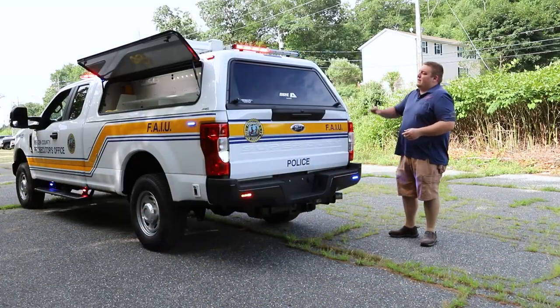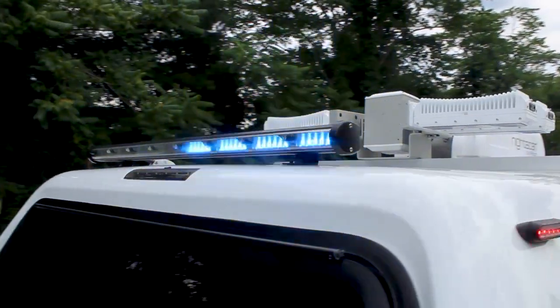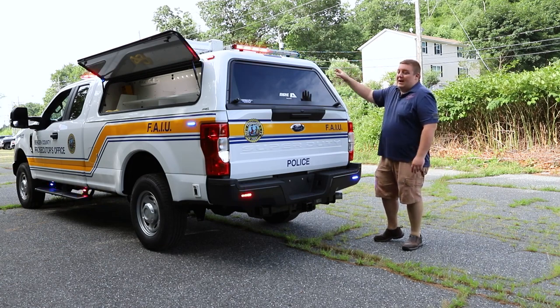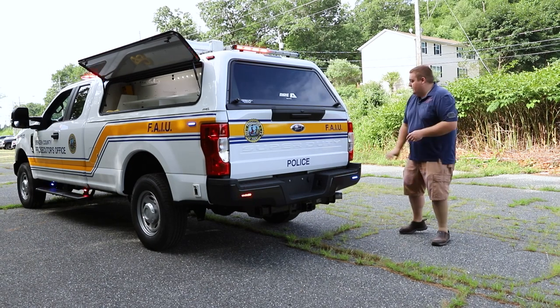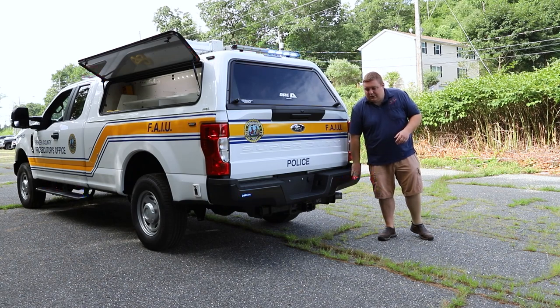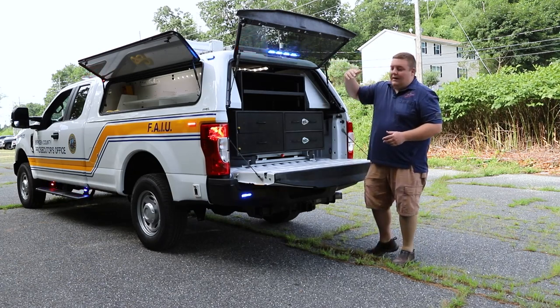Taking a look at the back of the vehicle, we have an 8-module SoundOff Signal traffic controller in tri-color — flashing red and blue, an amber arrow stick override, and a white scene override tied into the reverse lights. In the tail lamps we have SoundOff Signal hideaways. On the bumper we have 4-inch SoundOff Signal M-Powers, which also have the white override feature. With the hatch open you can still see warning light through the rear glass window.